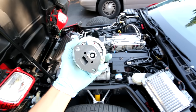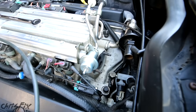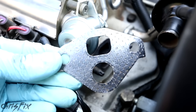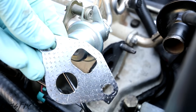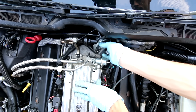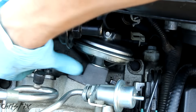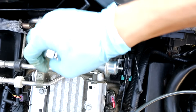Let's go install our new EGR — or if you cleaned yours, go install the original one. If you need a new EGR valve, you can find the link in the description. This EGR does have a gasket — they include a new gasket, but the one on here is perfectly fine so I'm going to reuse the old one. Installation is simple and the exact opposite of taking it off: slide the EGR into place, hand tighten both nuts, then tighten down both nuts evenly to 25 foot-pounds of torque. In this case I'm doing it by feel because it's too tight to fit a torque wrench in there.